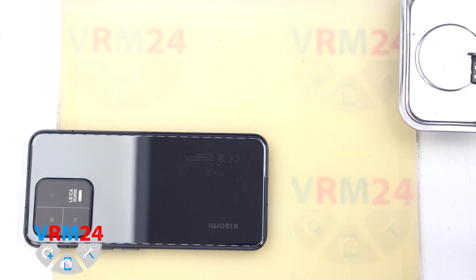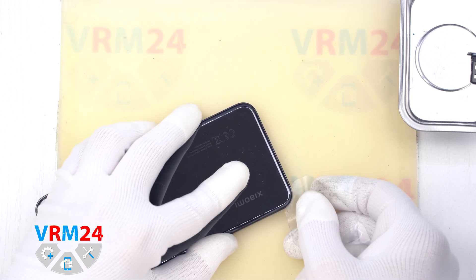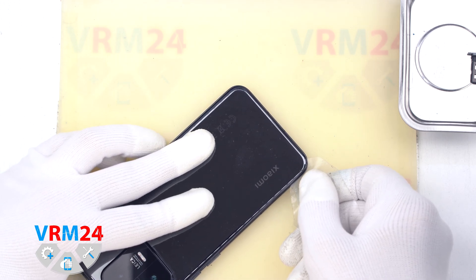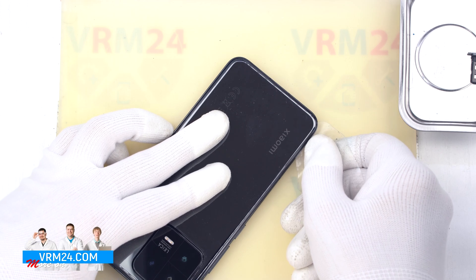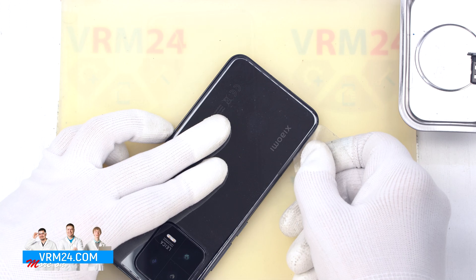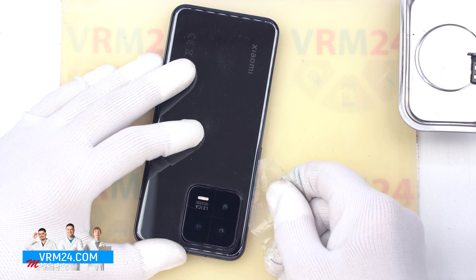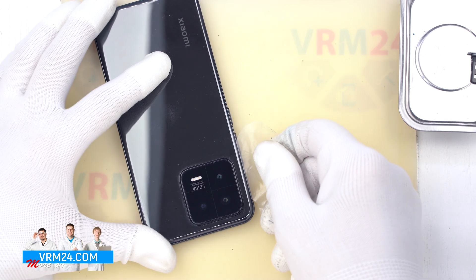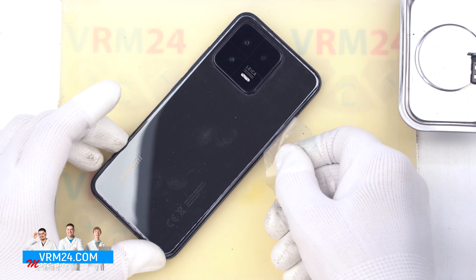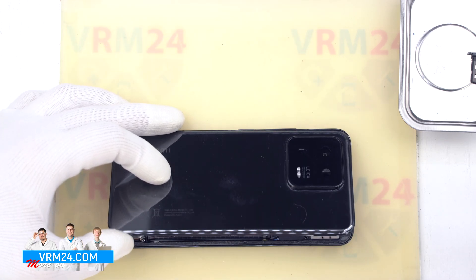After 5 to 7 minutes, we can move on to detaching the back cover. To detach it, we use a thin plastic film — this can be a protective film from a new display or a film from a stationary store. We carefully insert it into the gap between the back cover and the middle cover and gently run it lengthwise along the edge, cutting off the adhesive base. We need to be careful around the side buttons, as cables may be located there, and also around the cameras so as not to damage the lenses.